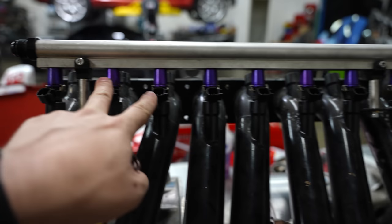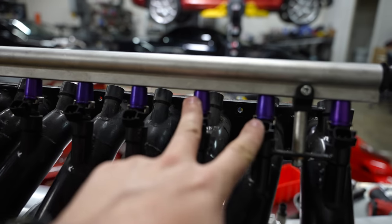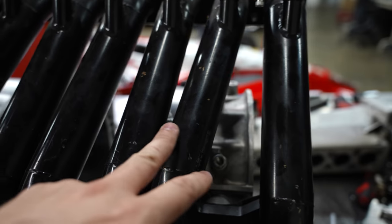I am going to take these two, and these two are actually going to go down to the primary rail down here. So these will just be blanks or maybe room for more injectors. I don't have the wiring for it, but we could have all 16 up here and four down here if the ECU allows it.